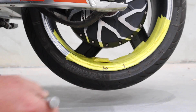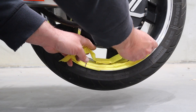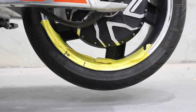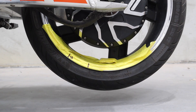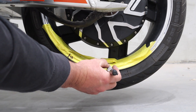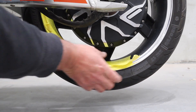So what do we do now? We put the weight on the other side. Now we're going to try the weight there — let's spin it up again. The vibration was a lot better here than it was in the original spot. So we're going to call that neutral and put an arrow there. Now the middle spot is there — let's see if we can improve it more.